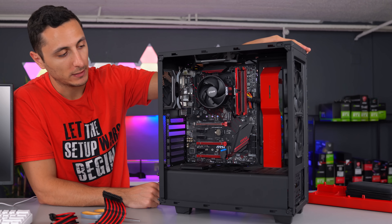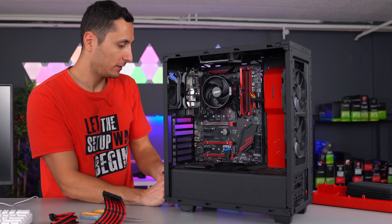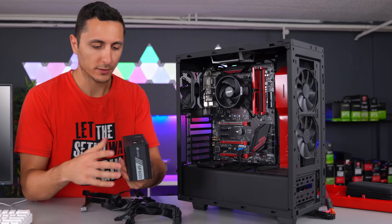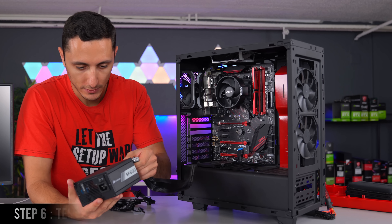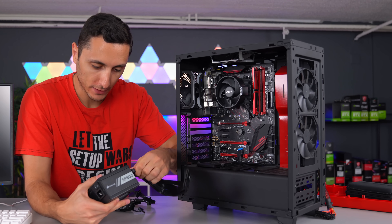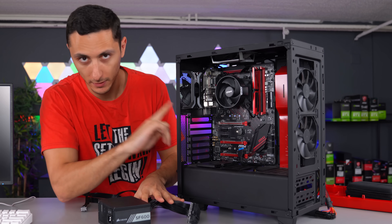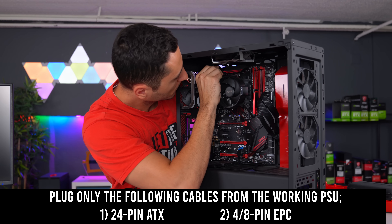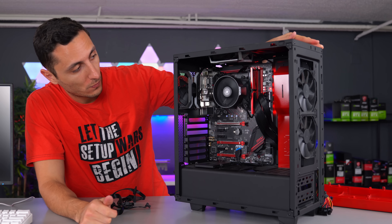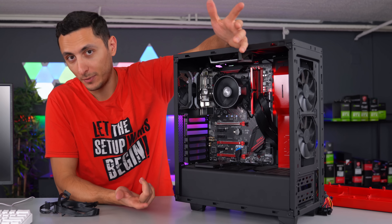It is not the extension cables. I feared it might be the power supply. So now this is where you take your PC to the shop — unless you have an extra power supply lying around, which is our next step. I'm going to be using the SF-600 from Corsair to test the system, leaving the original power supply in place for now. Plugging this power supply into the motherboard. That is promising — the fan is spinning. It does look like the power supply was the issue.